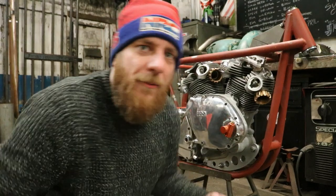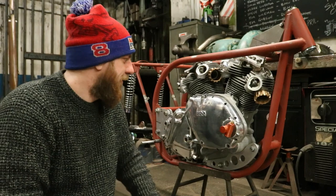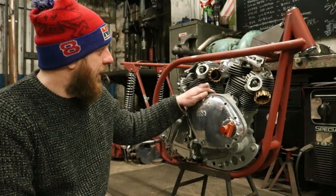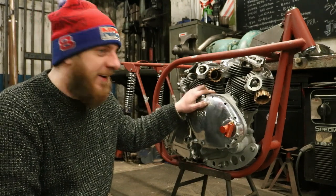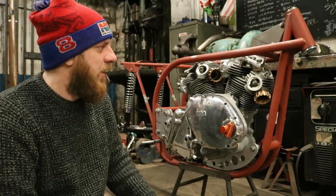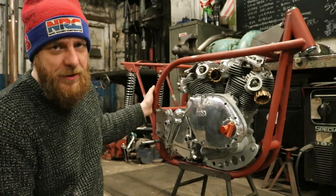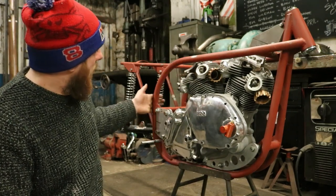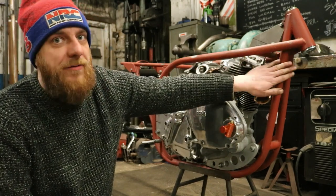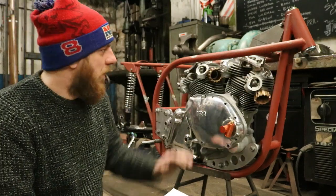This is what I've got - absolute special. I love these, don't know why. Just basically because that is the king of all engines. It's in a Manx Norton frame, or a Manx Norton replica frame - it's not an original one, it's a copy. General things that tell you it's a Manx Norton: this big radius on the back here, and road-going frames have a gusset where the race bike frames don't. So that tells you it's a Manx Norton frame.